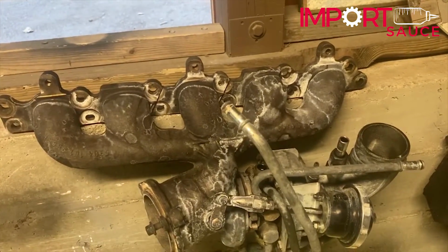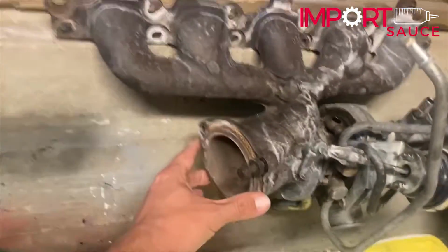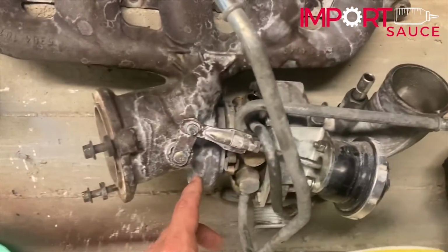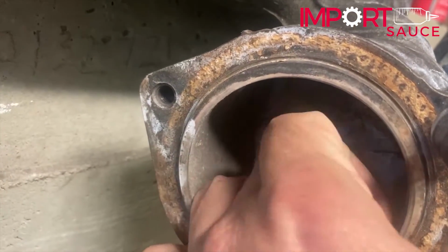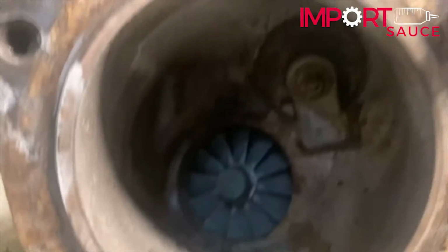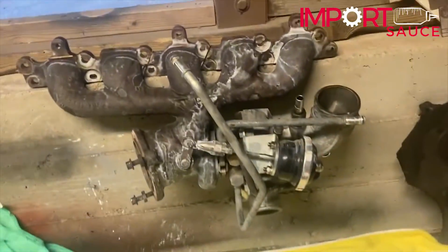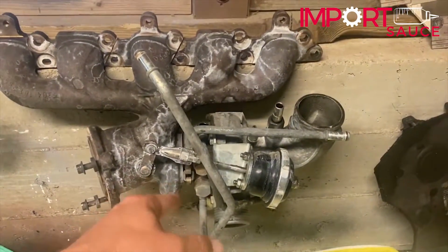Let's just simply talk exhaust gases, right? They're going to flow through here, and then this is going to connect to your downpipe. You have the 3 bolts that go on there, as well as your gasket that connects up to the downpipe there. And then inside, obviously, this housing, when the exhaust gases come out, we can see there is our turbine, let's see if I can get it to spin for you. And not, right. And then right there, you can see where the wastegate, the actuator, is going to open up and put function on that door there. So when it needs to, it can expel some of that extra pressure or gases that it needs to that are flowing through maybe this side.